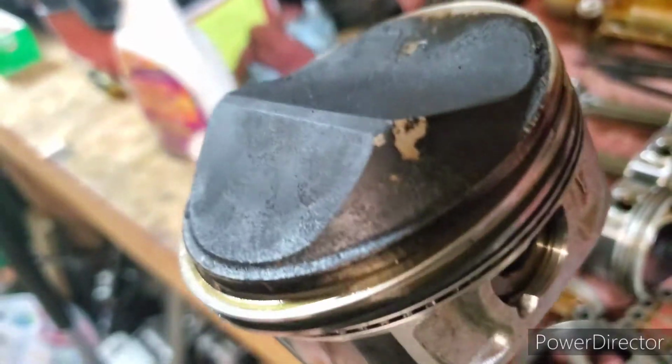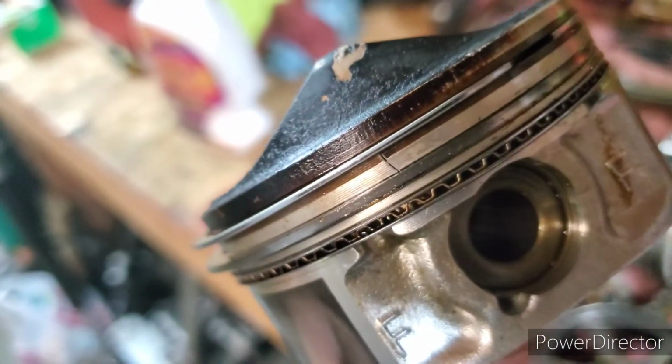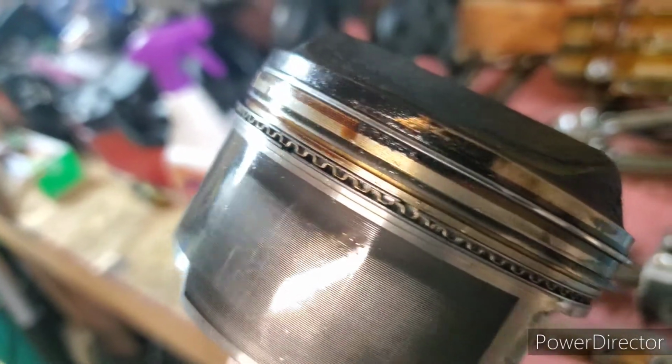Yeah, so I dropped cylinder 3 on accident when we were taking out the block, and we saw this crack, and we're like, oh, it must have just been because I dropped it. But now I picked that one up, and I could tell that one was cracked. So now, oh, they're all cracked. Every single one of them.